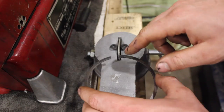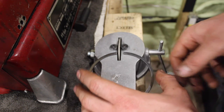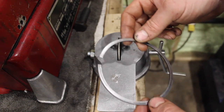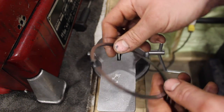Another thing to remember: the top ring is often different material than the second ring, so the top ring will take more turns to file down than the second ring. If you're doing the top rings first, don't get used to how many turns it takes, because when you do the second ring you'll find you're taking material off a lot faster.